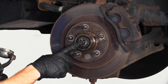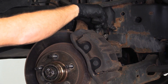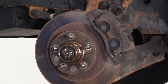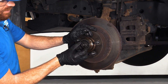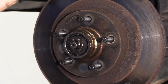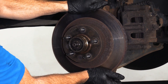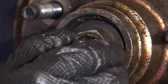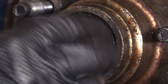To get this apart, I'd remove this cover like I did. We're going to remove the caliper and hang it safely so there's nothing putting pressure on the flex hose. Now that we have the lock out of the way, we have a clear view of the nut right here. This is the adjustment nut that controls whether you'll have movement from the bearings or not. You can see we have quite a bit of movement, meaning this is de-adjusted too far. And if I can turn it with my fingers, that's a definite cause of why it's loose.